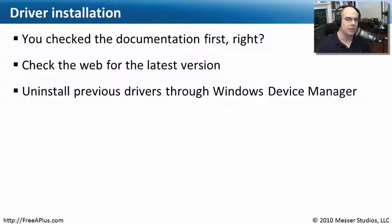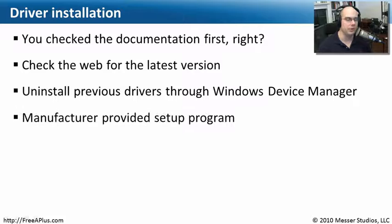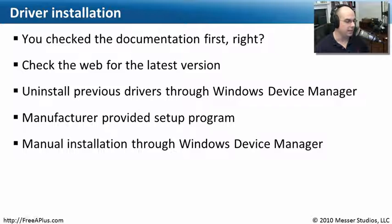If there are existing drivers, consider uninstalling those. Use the Windows Device Manager to uninstall the old driver before you install the new hardware. You may want to look at the manufacturer's driver itself — there may just be an installation program that already recognizes you have a driver installed and prompts you saying, 'You already have this driver — do you want to uninstall the current driver and install this new driver?' Unfortunately, not all manufacturers provide that, so you may have to manually go to Windows Device Manager, uninstall it, and install the new driver from there. The installation and uninstallation can always be done through the Windows Device Manager.